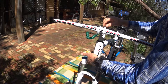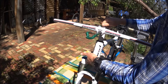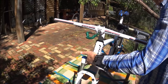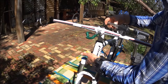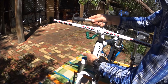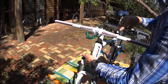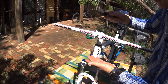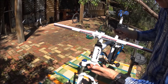Then goes this screw with the top cap, which you tighten to the point where there is no play in the fork. Right now there is play, so you tighten it until there is none. What this does is compress the whole mechanism against the bearings to prevent any play.